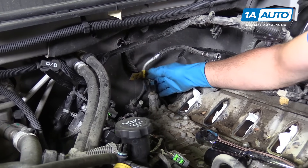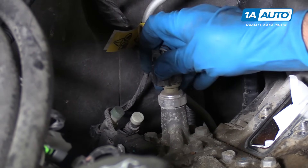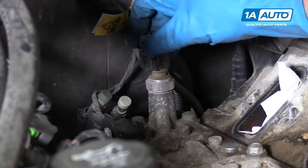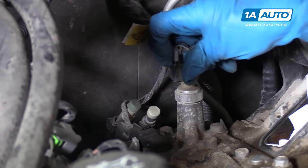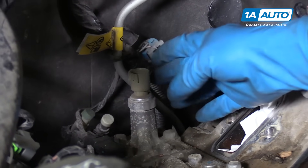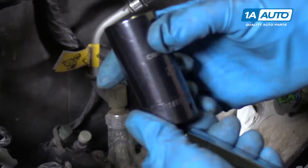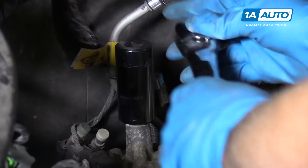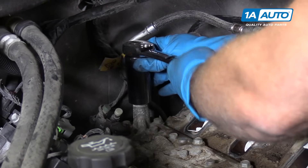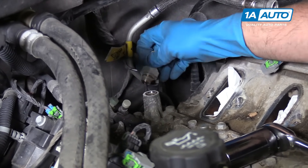The oil sender, or oil sensor, is back here. You can replace this while the intake's on — it's just easier to show. It is recommended to do it this way so you can see more. So we're going to lift this clip right here — that's the lock that locks the connector down. We can push down on the terminal lock and that will release the connector. They make a special socket to replace this sensor. If you don't have one, you can use a 1 and 1/16 socket — a deep socket — or a 27-millimeter socket will work as well. Then we'll use a ratchet. Once you break it loose, generally it's pretty easy to take the sensor out by hand. And there's the sensor.